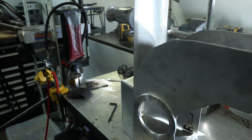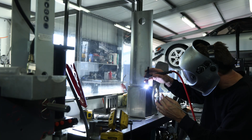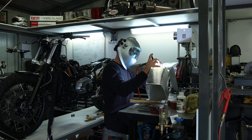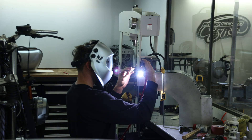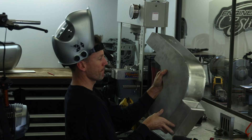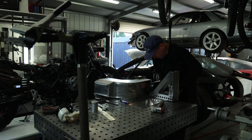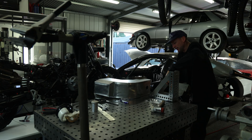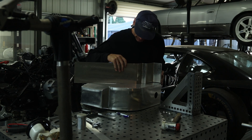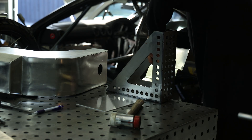I'm using 2mm aluminium sheet to fold up the complex outer perimeter of the tank. Going 1mm thinner here allows me to hand fold most of the bends while still being thick enough to weld onto the 3mm side plate. Bends in close succession are not easily completed on anything other than a press brake folder. Because I only have a pan folder, I resort to using my homemade workbench and 90 degree supports. You can find the DXF files for this bench over on my website.